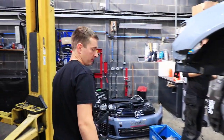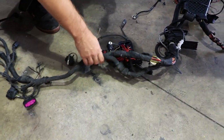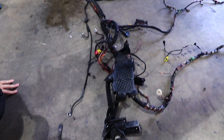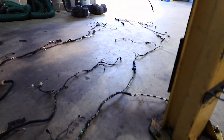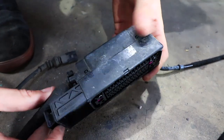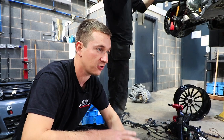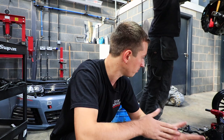This is the rest of the stuff that Paul's been pulling out of the Mark 6. All the wiring is going to have to be stripped back, all the crap we don't need got rid of, and then we'll make it all look nice and neat and clip it up nicely in the car. The ABS should plug into our ABS pump, but we're going to separate this out into two separate looms - so the ABS is totally standalone to the engine loom, which is totally separate to the car loom. So if you had a problem with one, you're not burning up everything.